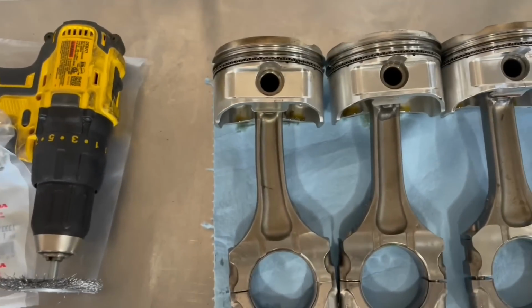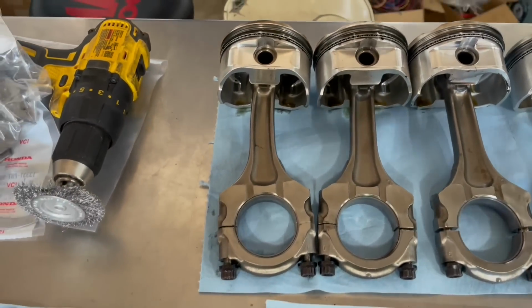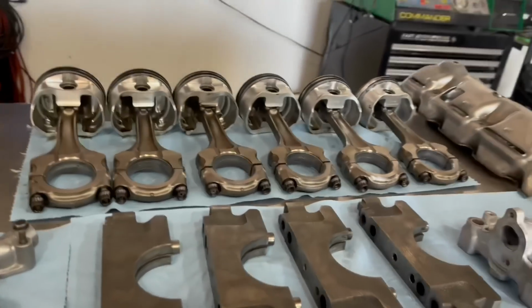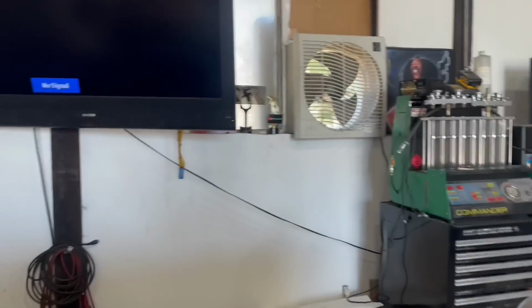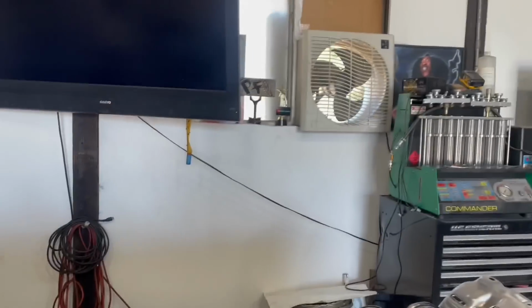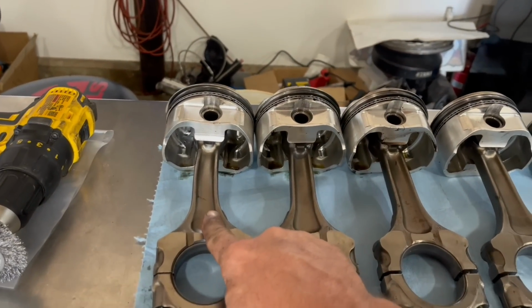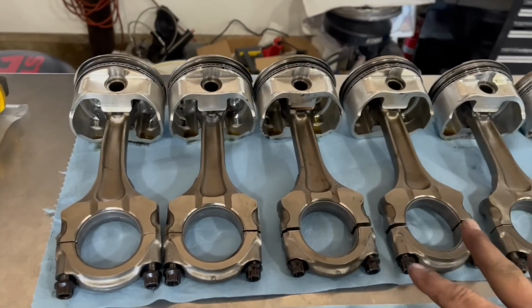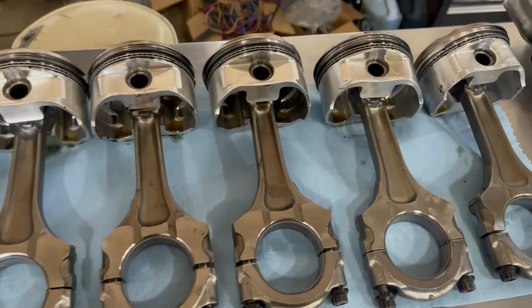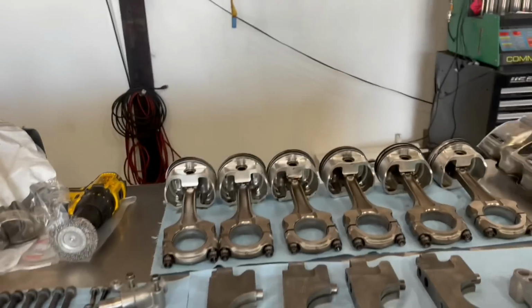And wouldn't you know it, we've got a banana in here. So there's a problem. I bent a rod on the old NSX engine. Now these are titanium rods, they're really good rods. I do have a friend that may have some, because I may do the three that were in that bank. This one looks like the only one visually right away, but there's a couple that are kind of suspect, we'll need to measure. So I'll be measuring all those and coming back to this.